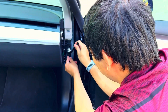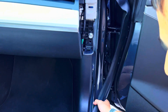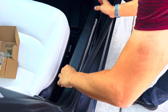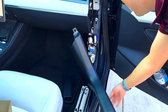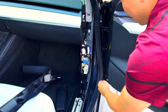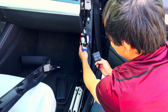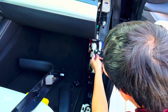Get in right here and just pop this out gently, and make sure you don't lose this because it's really important. Next, move a little bit more of the weather seal down here and all the way up to this gap, then just lift up gently — there you go. You want to lift it this way because it's easier to remove. Make sure you don't lose this little foam block either. Set this aside and you'll see the cable harness included with the TestLogic device — this blue device reads data from the CAN bus, and the other components provide power to auxiliary stuff.